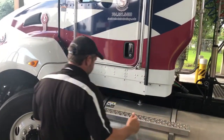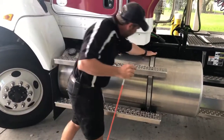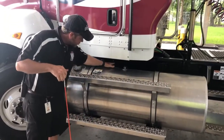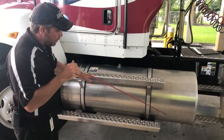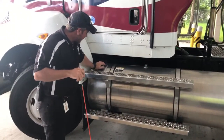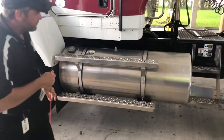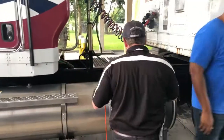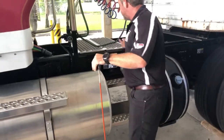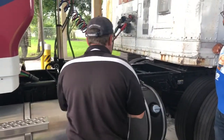As I check my steps and fuel tank area, they all have to be nice and secure. The tank is secure with all its nuts and bolts, the straps are in place with the rubber. I don't see any leaks from the actual connections of the tank, or any damage, cracks, or punctures to the tank. There's no leaking from the cap — the cap is nice and tight, creating a good seal. You don't see any leaks underneath as well. I'll also check the catwalk and steps — make sure the steps are secure, the catwalk is nice and tight, and there's nothing that will let me slip or fall, like grease, oil, or ice.